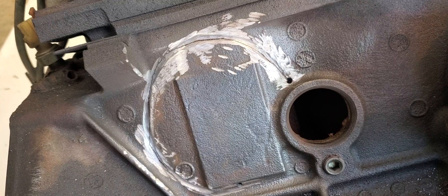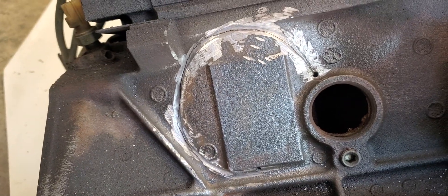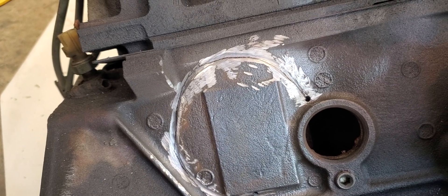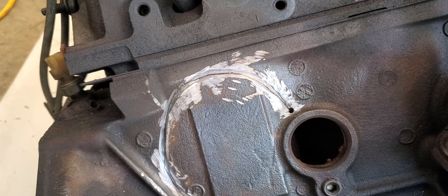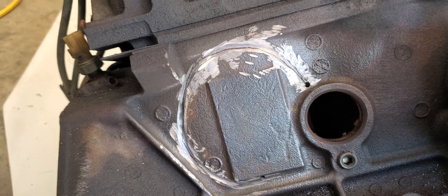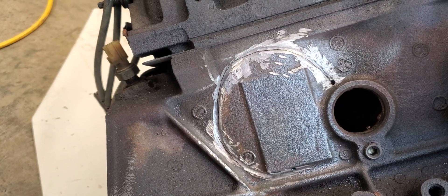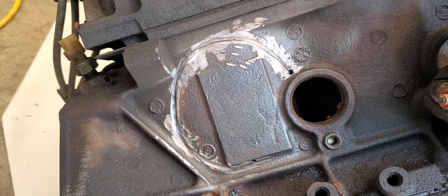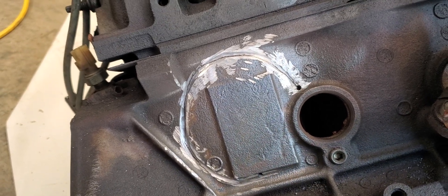What I'm going to do is start where I made that hole and weld small sections — half-inch stitch all the way around to the bottom — take it past that circle, then let it cool just a little bit. I want to seal it up so it doesn't leak. It's the water jacket side of this motor; if it doesn't leak there's no pressure on it, just the water pump circulating liquid coolant. I'll get the camera set up on the tripod. Remember to share, like, and comment — let me know what state or country you're from.